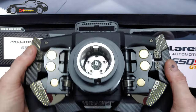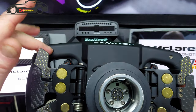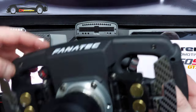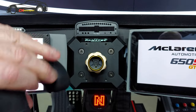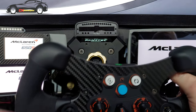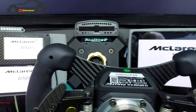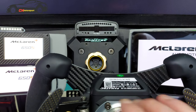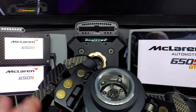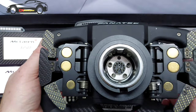I've put the podium paddles on the back — a pretty easy job. You take the screws out the back, remove the cover, undo the original paddles, undo two screws at the front and bottom, which allows this cap here to come off. Under there are your connectors — you just unbolt them, take off the quick release, undo the remaining screws, and the unit shifts apart so you can fish your wires out.